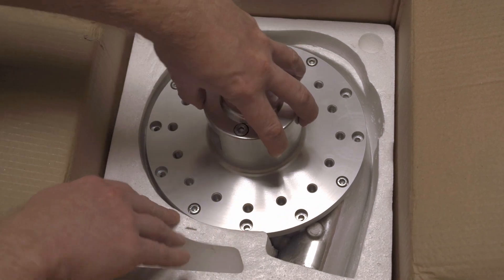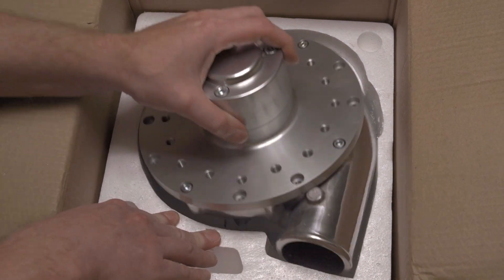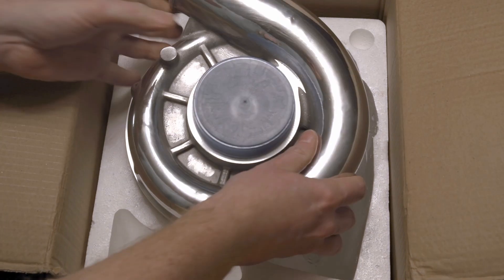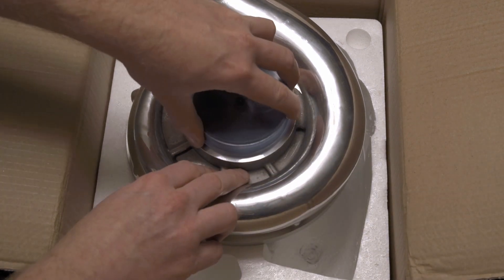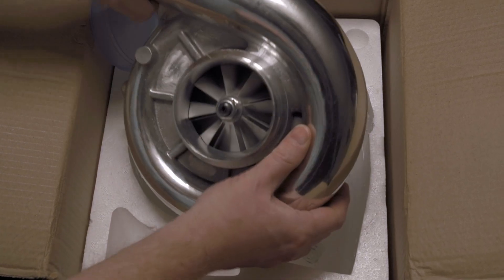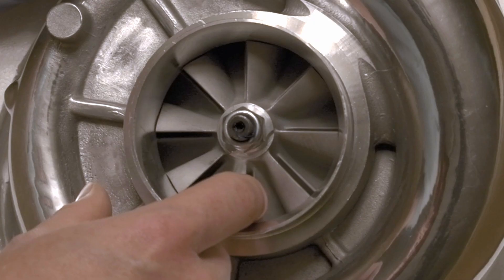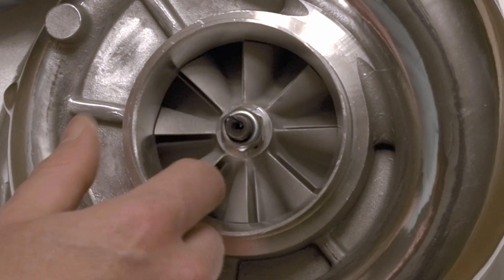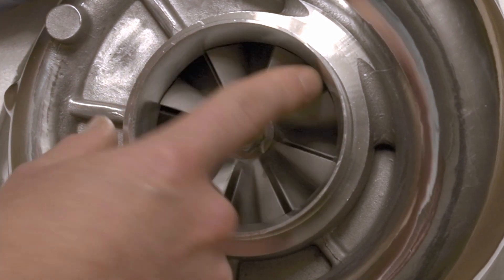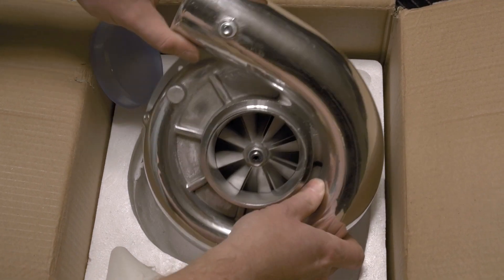There's a billet backplate, this is a bearing hub, and it doesn't have a gear drive, which makes it even better for our purposes. It's a polished unit — probably just to cover things up. Taking a close look at the impeller, the clearances are pretty tight. I can stick a feeler gauge in there, but it's comparable to what the Vortex setup is. In fact, almost all of this is identical to the Vortex deal.